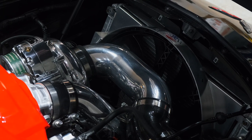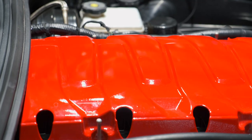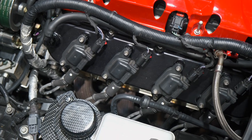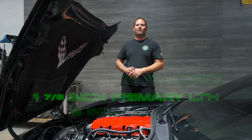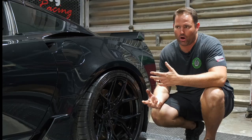With any performance build, what goes in must come out. In this case we've got a supercharger making six pounds of boost forcing all kinds of air in the cylinder, and the cylinder heads and cam are doing everything they can to get that air moving through and out. So we mated this entire engine build with a long tube set of headers from American Racing — one and seven-eighths primary to a three-inch collector — and a three-inch off-road X-pipe that mates to the factory NPP mufflers.